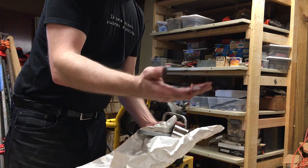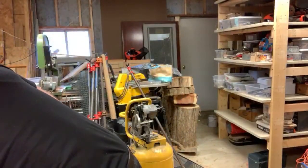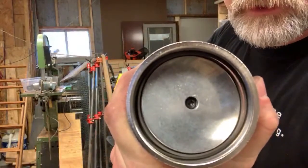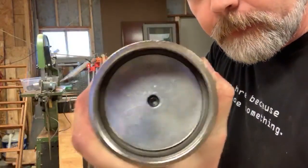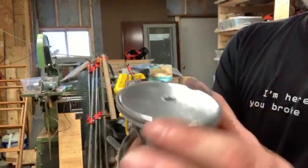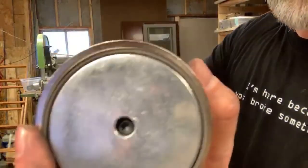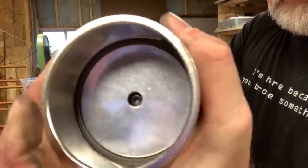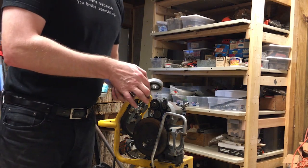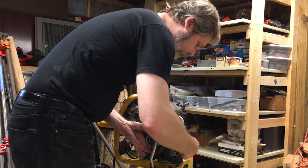Got some gaskets to replace the old ones. Here's the new piston. You can see it fits nice and tight. Any gap that you think you're seeing there is just a reflection. There's actually a little bit of rubber seal that's totally missing on the old one. This just seals up real tight. Just basically put this back in reverse order — insert the collar, insert the piston.